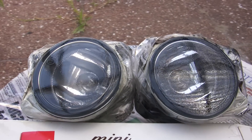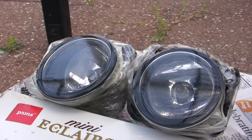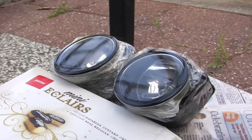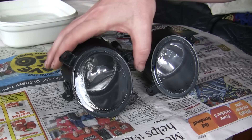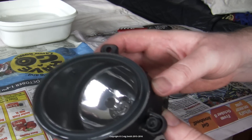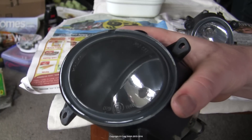So I did three or four coats. It's always best to do more coats of a thinner nature, as opposed to fewer and thicker coats. Especially if the lenses are more vertical than this when you're painting them, because you risk developing runs if you spray too much at once. And then you'll ruin the entire job if you develop even so much as one run, and you'll have to take it all off again and start all over. So try to avoid that.